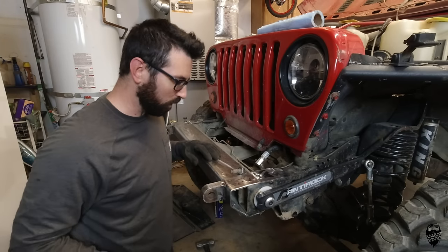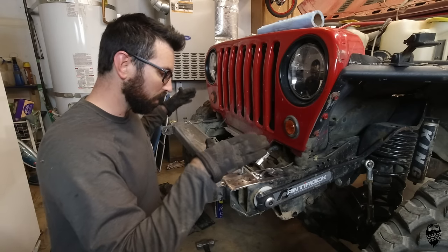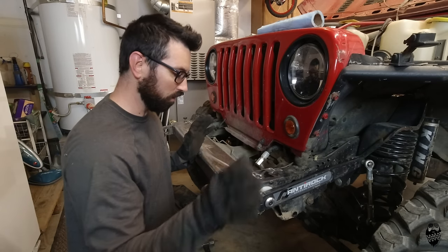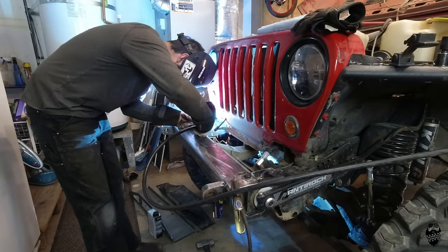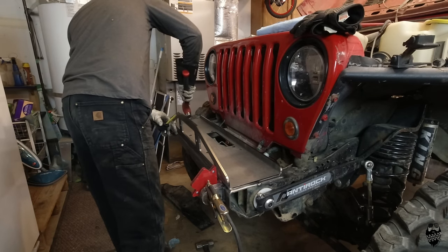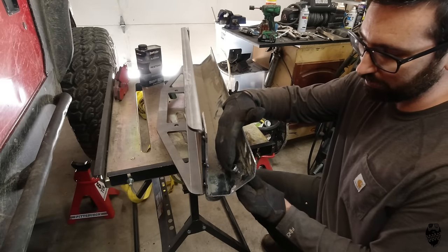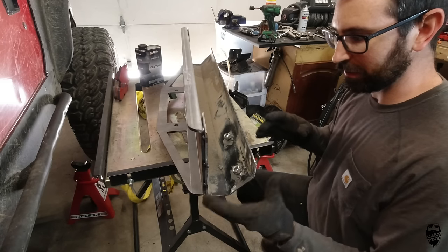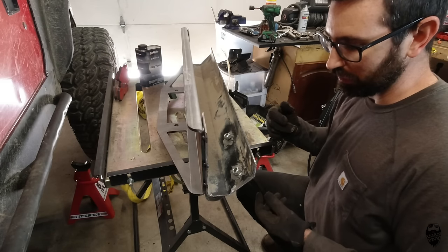Next up, I've got my plates mounted where I want them. I'm actually going to bolt this top bumper and these plates down, tack weld the sides of it, set the plate down on top, tack the plate to the top, and then drill all my holes from the backside so everything is in the perfect location. Also, specific to mine, I have bolts holding my skid plate for my steering gearbox bolted to the front here, so I'm going to weld the nuts on the backside before I start assembling everything, since I won't be able to get to them easily later.